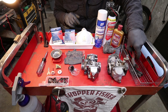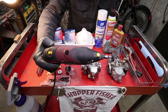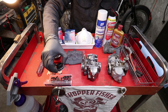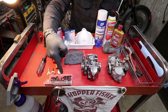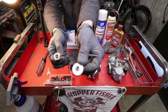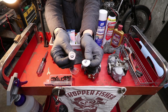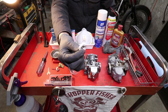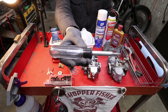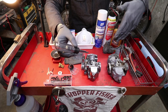First, you're going to want a basket of wire brushes, a bottle of degreaser, and a Dremel. I recommend using this guard for your Dremel for the wire brushes because those things are insane. You're going to want a little bit of buffing compound. I highly recommend the Dremel brand buffing wheels over the knockoff brands. The knockoffs fray into nothing in a matter of moments, where one of these will last pretty much the whole carburetor. This specific Husky 6-in-1 screwdriver has a bit that fits every single thing on these carburetors.